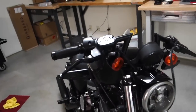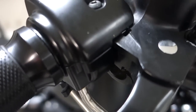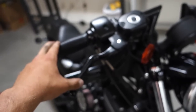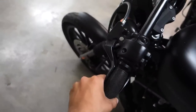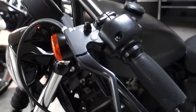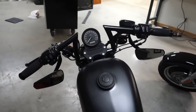Make sure for your brake — make sure you hear a clicking noise. When you squeeze the brake just barely, you should hear a little quick clicking noise. If you don't hear that clicking noise, your front brakes are not going to be working, and you don't want that. Over here, make sure when you're squeezing everything it feels right and it's pushing up against that little lever in that crack.